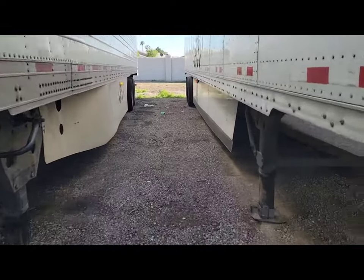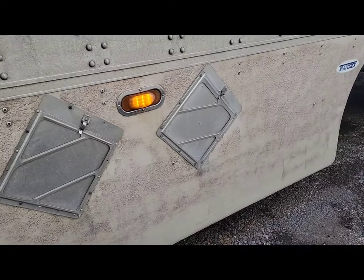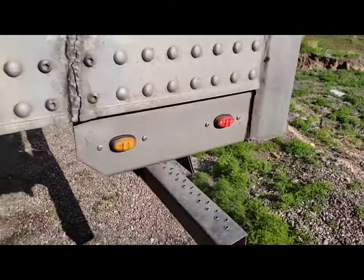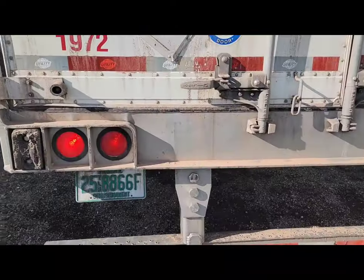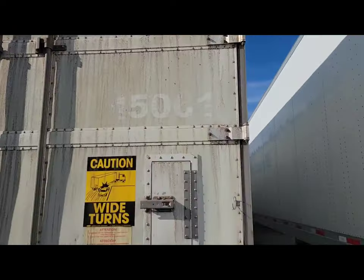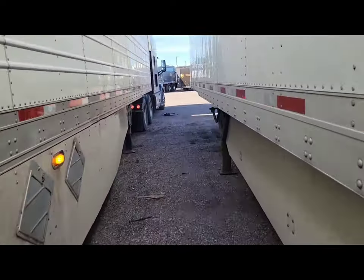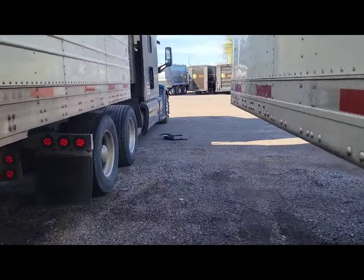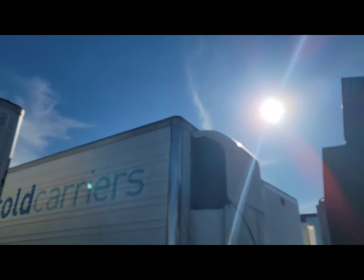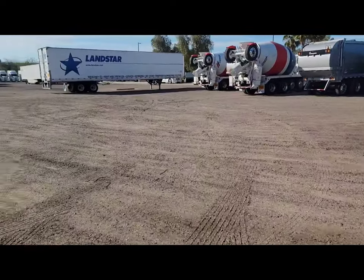Now for the test — I've got my pre-trip button going, turn signals going. All the lights are working, keys are on, tail lights are good. Everything is good. I'll check the top clearance lights and we'll be alright. Yep, that's working too. I'll get around to the other side and look at it — it's working.